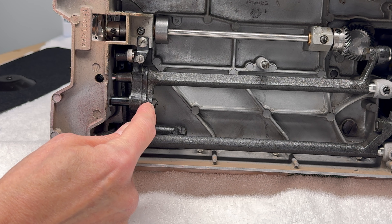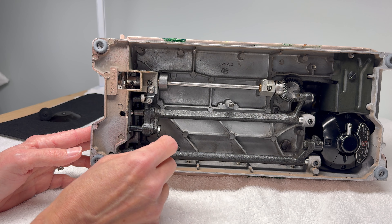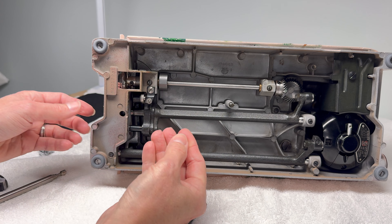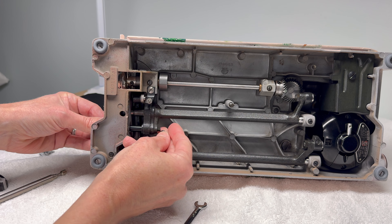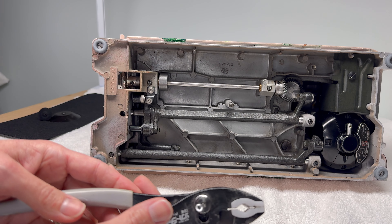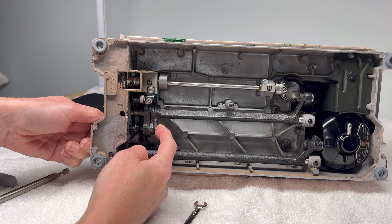Do you see this little nut right here? We want to loosen this nut. I have a little wrench here — it is a 9/32nd, which is the size that fits on this nut perfectly. Put the wrench on the nut and pull down to free it up. The purpose of this nut is to keep the screw from coming out all the way when you are lowering the feed dogs. Once you remove that nut, try again with your non-marring pliers on the end of the knob and go ahead and take it all the way out — it's a long screw, so just have a little patience.